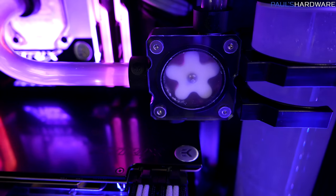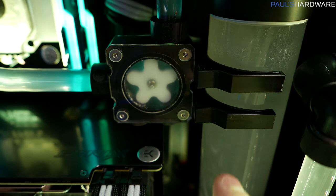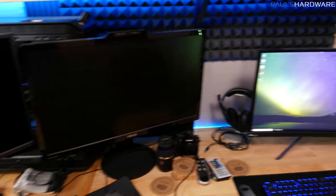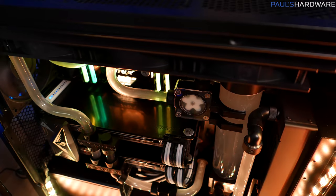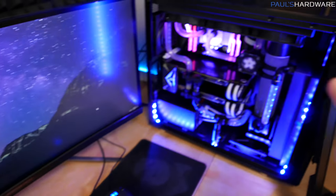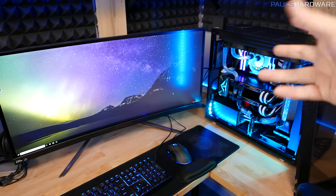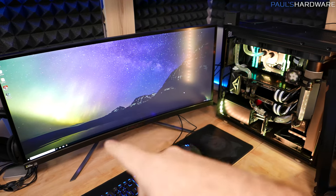I spent 15 minutes this morning before I started this video because suddenly my flow indicator has stopped flowing. As you can see, the fluid is still swishing around in there. After my main system stopped functioning, I was using this system to play music. Then this morning I noticed the flow indicator isn't flowing — I tried turning up the pump speed, went into the BIOS to adjust it eight or ten times, with no effect. And as I was restarting this system, I was getting a CPU fan speed error message even though the fans are spinning. It somehow isn't detecting it — it won't let you boot into Windows because it thinks the fan isn't spinning.